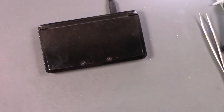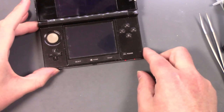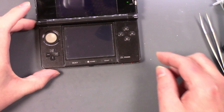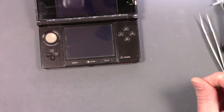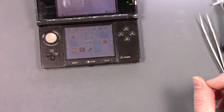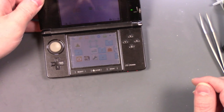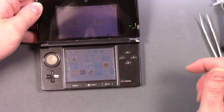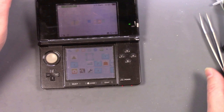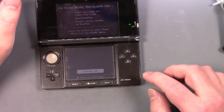Popping back in on this — it is drawing 700 milliamps on the charger now. I don't know if it will power on, but it is definitely taking a charge. The power light is red. I'm drawing one amp of current now, and there it goes — so it is working. It's charging up, it works. It's showing that there is a charger connected and it is working. So this is a working 3DS now, and I will now talk about what we're going to do to this unit.